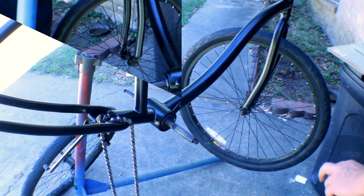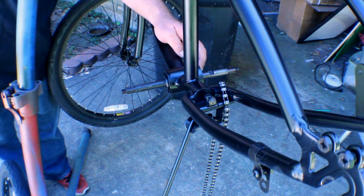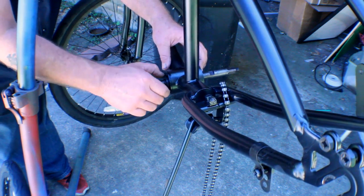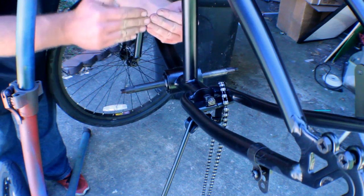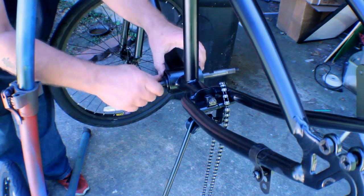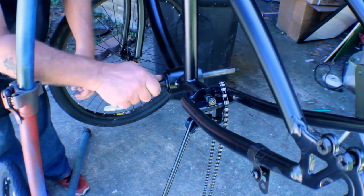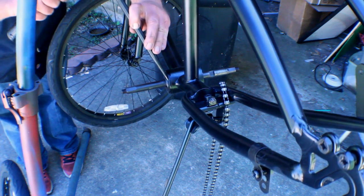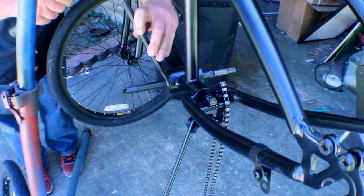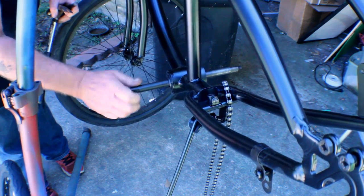I've got it good and tight. I've got my bearing cage cap tightened up on the right side of the bike. You want to make sure there's no play in your shaft — that it doesn't rock side to side or move in and out. I've got it fairly snug; I don't want to get it too tight because I'll damage the bearings. The shaft turns freely. Let's go ahead and put our lock nut on — take a punch or screwdriver and give it a couple of taps to tighten that lock nut up. Make sure your shaft turns freely and there's no play.